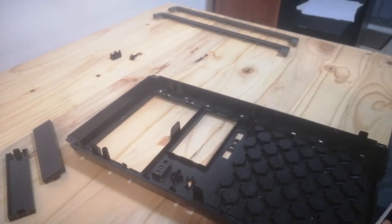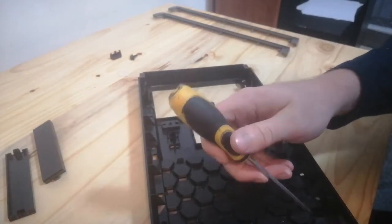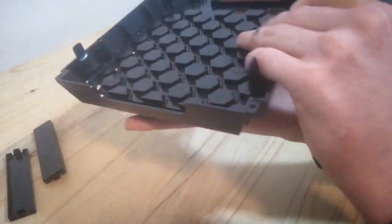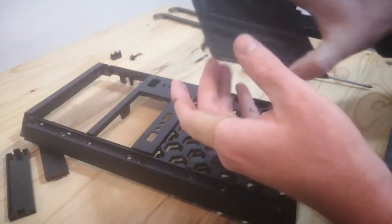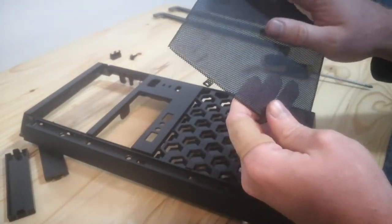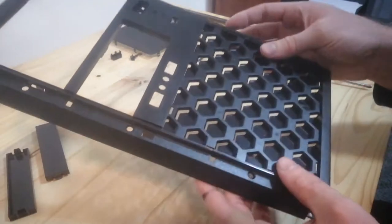Thing is, you don't want to pry these off and twist and twist and twist until you break them. Okay, so easy to that. Comes out without a problem. This part I'm also going to respray, so I'm going to scuff all of this up. Not too much as to go through the existing paint. Still want the new paint to grab onto something.